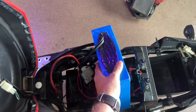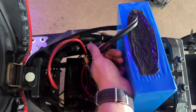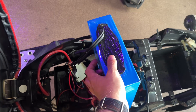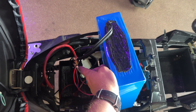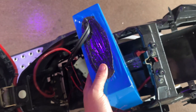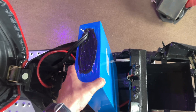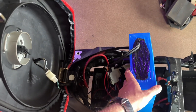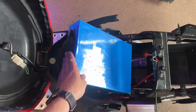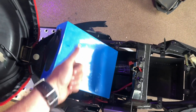We got up to 30, but I do still kind of just have the wire wrapped around everything and it's still going through an XT60 — and the wire is warm. So I'm definitely going to have to open up this pack and try to get some bigger wire in there, or get a second one of these packs and parallel up XT60s into an XT90. I might do that — I think there's enough room if I pull out the battery boxes or modify them to fit a second pack. But this is a lot of money; I think this is like 4.5 kilowatt-hours or something like that. Not entirely sure what I'll end up doing, but it's good to know as a proof of concept. All I really have to do to get this thing working is get a DC-DC converter, and then I can get rid of the other 12-volt batteries. E-bike battery success, more or less.